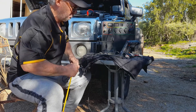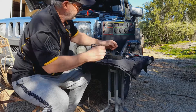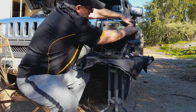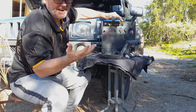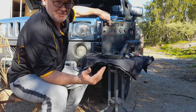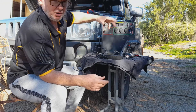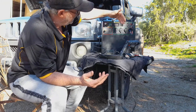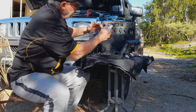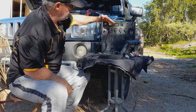To reset this is actually quite simple. You just take the charger off — you don't even have to take the charger off. What I'm going to do is draw from the unit. In the instructions, we say draw more than an amp out of it, because it depends on the state of voltage that's in the unit as to when it's going to reset. If you pull an amp out of it — a couple of USBs, a light strip, or something like that — that should be enough to reset it. So now in theory this is reset. Let's plug it in again. It charges.